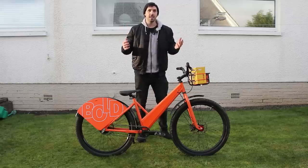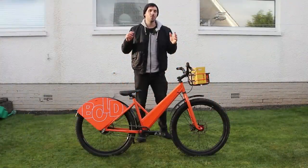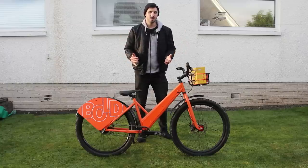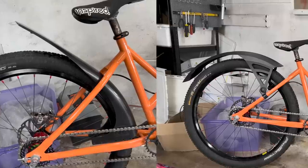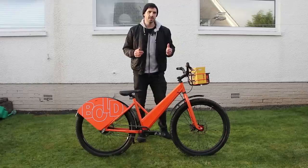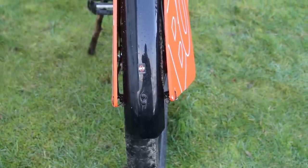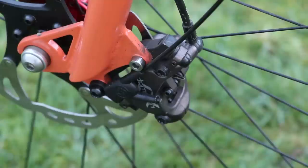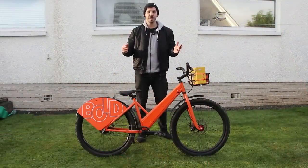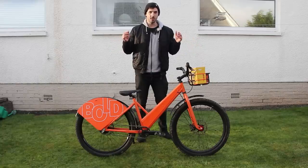With the bike fully built and rideable, I went out and tested it — it felt really, really good and I genuinely enjoyed riding it. But it still didn't look like a hire bike, so next I needed to disguise it with street accessories. First I tried a few mudguards and settled on a fairly traditional wrap-around style. I modified them slightly so the front wheel wouldn't hit the bottom of the front guard, and trimmed the rear so it wouldn't scrape the ground when I went off the back. I had to drill and tap holes in the frame to mount them, but they ended up bolted on solidly — they haven't moved or caused any issues.